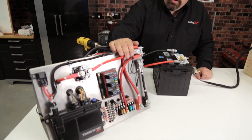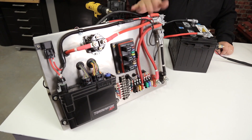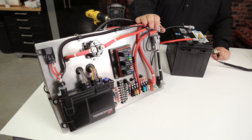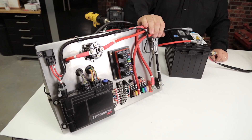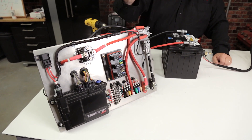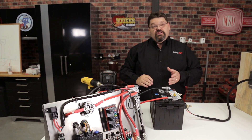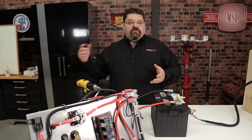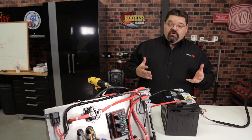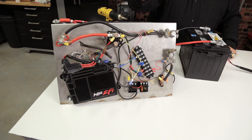Here are a couple of examples of clean wiring that's ideal in a vehicle. In this mock-up of a battery we've got top post battery terminals — positive and ground — some distribution studs and distribution blocks. Notice that the ECU power and ground go directly to the battery terminals, not to the starter solenoid or distribution blocks. In contrast, a lot of older vehicles have had aftermarket stereos, lights, and multiple repairs, and when you open the hood you may see a bunch of old T-taps, wires twisted together, and wire nuts. Wire nuts are for houses — they're definitely not designed for cars.